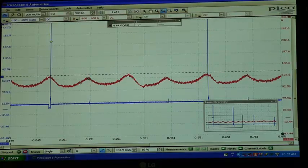We can see the peaks of cylinders one and four are looking very good, but cylinders three and two are very low — they're in the middle. So we now know our low compression is on cylinders three and two. How cool is that? How quick was that to find out? Amazing how quickly we can use modern technology with these lab scopes. There's not a day goes by that we don't use our lab scopes in this workshop. When you see the results and how quick it is, it just blows your mind.